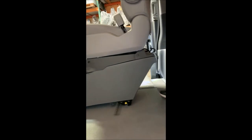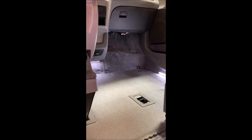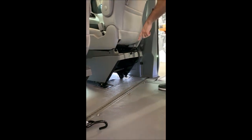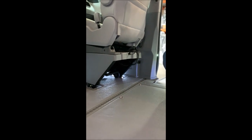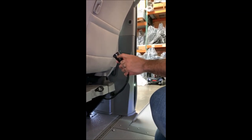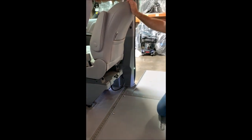Then just roll it back and take it right out of the vehicle. To put the seat back in, you're going to have these little hooks on the front side that lock into two little spots towards the front firewall. It's going to go in just like that. At the bottom, with your foot, there's going to be a lever — hit down with your foot and it will lock in. Push down onto the seat to make sure it's locked in, and give it a wiggle to make sure it's there. Grab your connector — a yellow marking tells you the top of the connector — then connect it back in and twist to secure it. The same process applies for the driver's side as well.